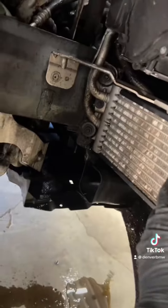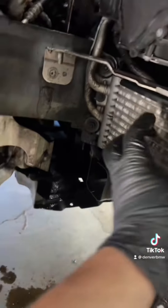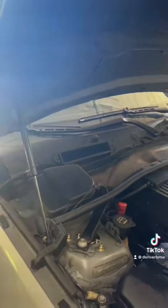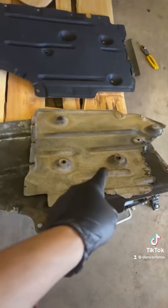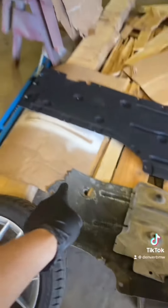As you can see, there's oil leaking from that oil cooler hose up in there. I have an aftermarket oil cooler coming in, so we're going to replace the whole lines with a larger aftermarket cooler. I did try to put the OEM cabin filter in but I must have ordered the wrong one because it wasn't fitting, so I just left it for now.